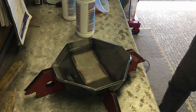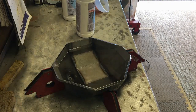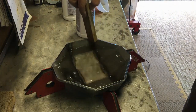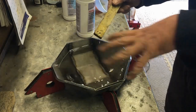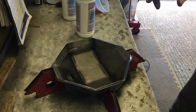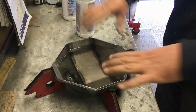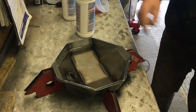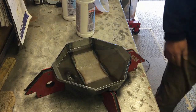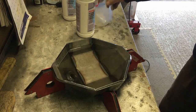We'll do this again to check the weld when we do the actual welding onto the axle. With a small brush — or I'll use a piece of wood — I'll splash this up into that joint, and I'll see if I have an issue in that area. Capillary action will pull it through the joint anyway because I haven't welded the inside yet. That's why I'm doing this now: if I find a problem I can sort the outside. If I welded the inside first I wouldn't know which side is porous.